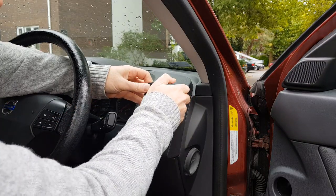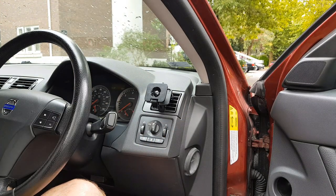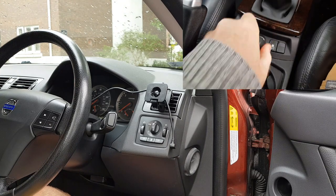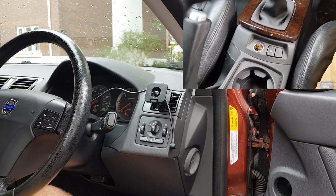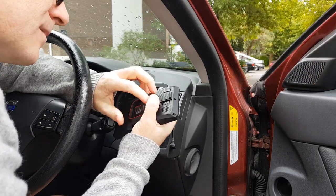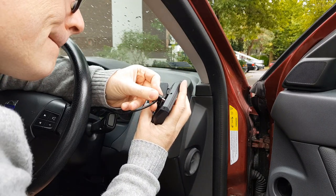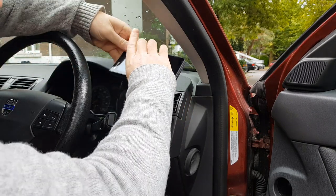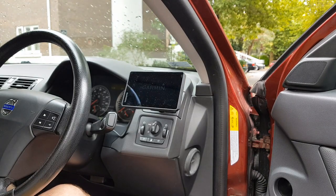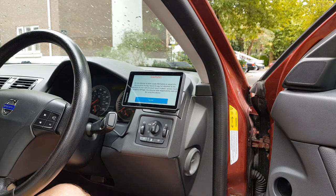Just for completeness, here's how to install in the car. First attach the bracket to whichever mount you're going to use — I'm using a vent mount in this case. Next trace the cable over and plug it into a power socket. Finally attach the device. With this new design we have to plug the cable into the back of the device; the previous Zumo 590 and 595 had a powered car cradle so you could just snap it in, but now we have to connect the cable separately. That actually irritates me so I'm going to be making a future video on how to make a powered cradle. The device powers up and is now ready to be used in the car.